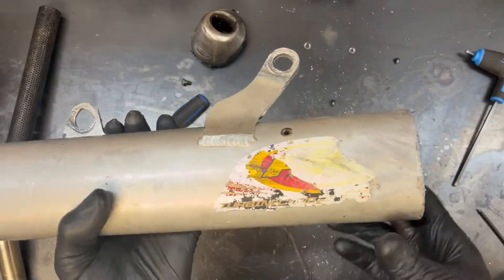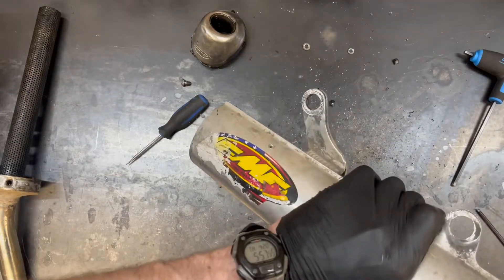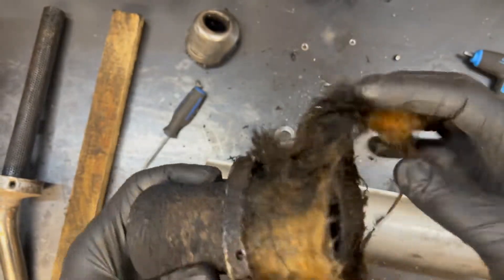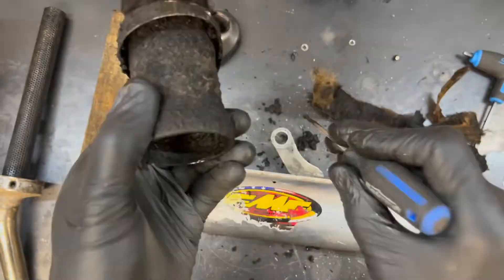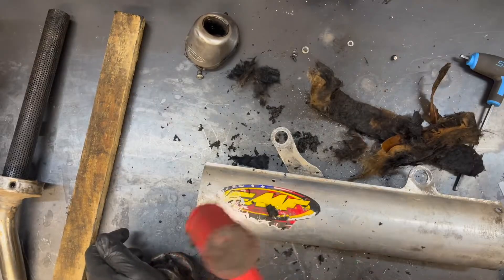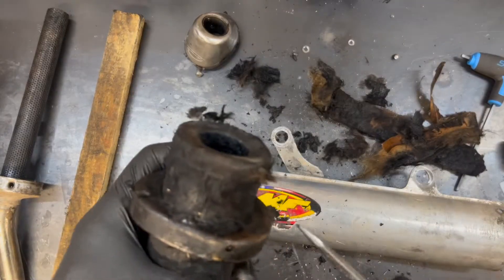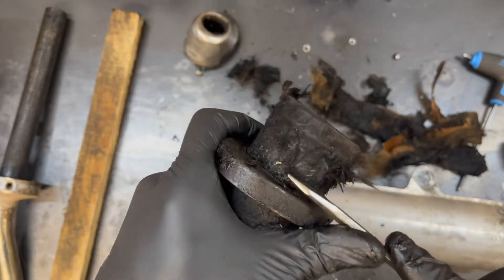Okay, all the rivets out. Now this turbine core can often be quite tight in there, so this is usually where I go to my wood pile. That is why I take the end out — it's probably cheaper just to just get a new exhaust. Not to mention, sometimes when you get these things apart you break them. This fiberglass in here — if you're not careful you'll be itching for days. If you do this with a wire wheel, this fiberglass is going to go all over the shop and in your face and in your clothes.